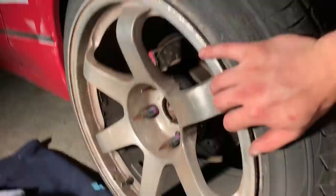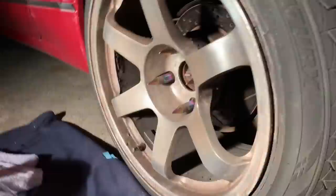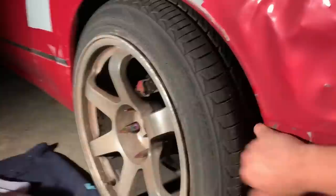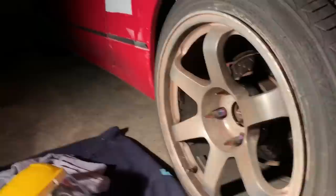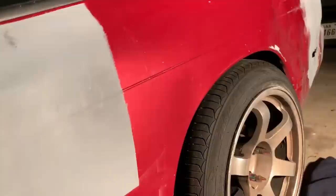We're not taking the tire off because someone forgot to bring an impact, a lock key, and sockets. So what we're doing is just lifting it up so we can have enough clearance to cut the fender — it worked on the other side perfectly fine. On the other side we almost had a fire incident because there's foam in here. You want to take off the pillar and pull out the foam, because when you're grinding you can shoot sparks and start a fire.